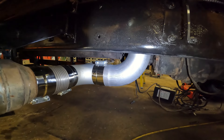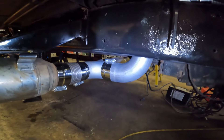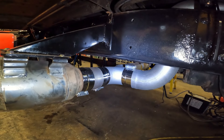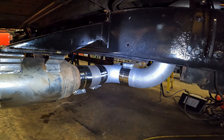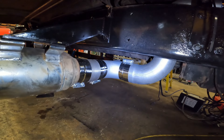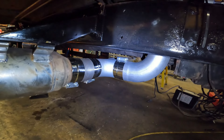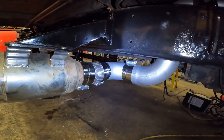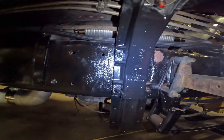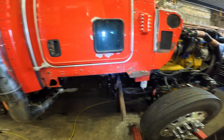The one exception I can think of is some aftermarket exhaust systems where you get a seven-inch exhaust that bells down to five, with picket elbows, and a Y-pipe that's tapered so it goes inside that five-inch. They bell it at the end, so you've got five-inch outside diameter butting to five-inch outside diameter — in that case you use a five-inch flat clamp. Other than that, use pre-formed clamps if you want your exhaust to hold up. Use brand new flex and brand new clamps.